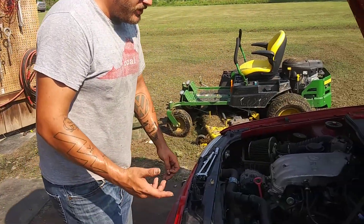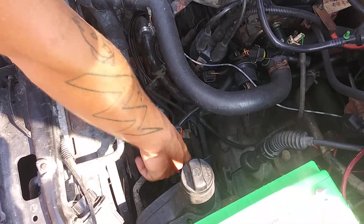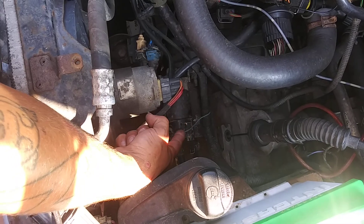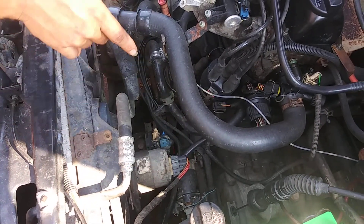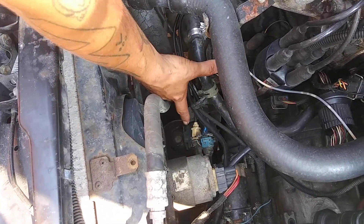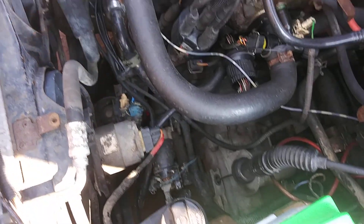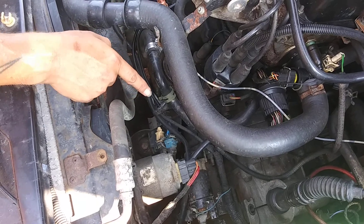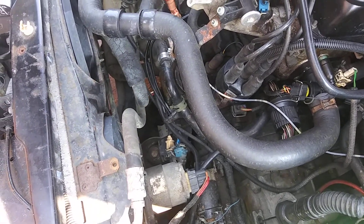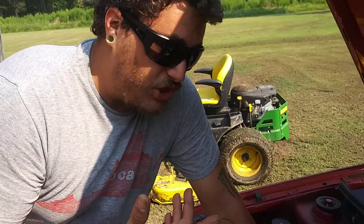What we're doing today is we're gonna do this here starter. The starter is right here, this whole thing right inside of here. It's not hard to get to, but what it is is this here front motor mount underneath of these connectors — that there is the backing plate for the starter to bolt in. So when you remove the starter, effectively you are removing the motor mount bracket from the engine. So if you don't have the motor braced up just right, it can turn around and shift, and then you'll fight trying to line the holes back up.